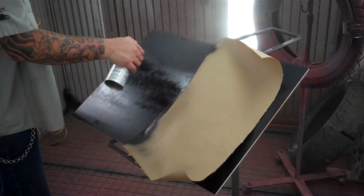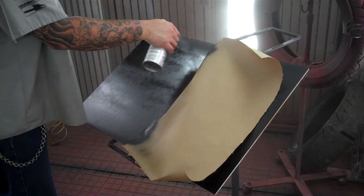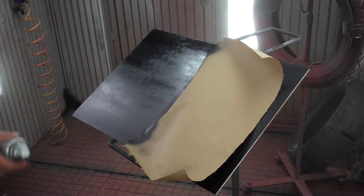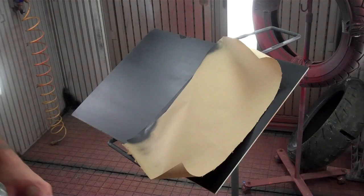I'm probably about six to eight inches away — I'm usually not this close, but with this heat today if I don't get this close the paint is going to pretty much dry before it ever hits the panel. I'm trying to do my painting in the morning before it gets too hot. You can see this goes on pretty heavy. Our last coat is going to go on real thick — this can is about out so I'm going to grab a new can.